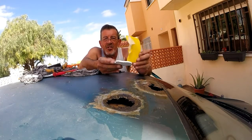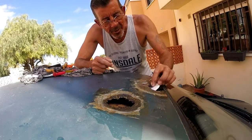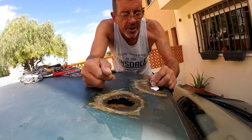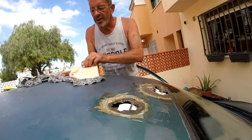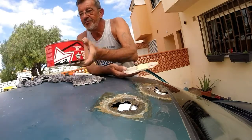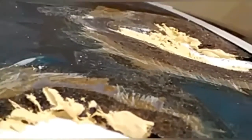The side that's going to be on the upper surface — you need to roughen that top piece with sandpaper, because the filler is not going to stick to anything that's smooth. You rough up that top piece and put a screw in the top, which will allow you to pop it in from the inside. You might need to trim a bit as you go — it's a trial and error process. Once you've got your two pieces inside, mix up just a little bit of the filling compound — one part hardener to a hundred — and put it between your new PVC and the underside of the metal.